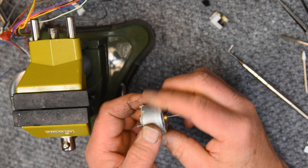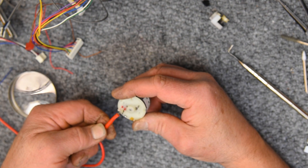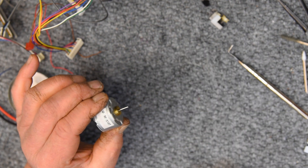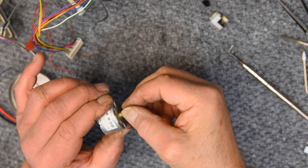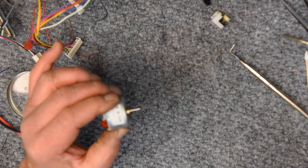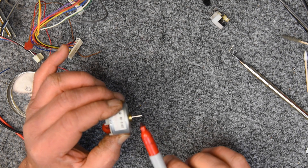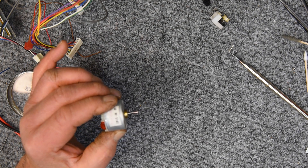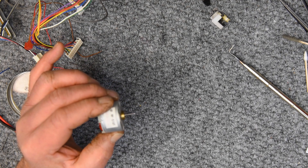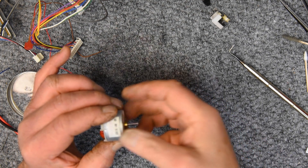I want to put a little bit of grease on the thrust side of the bearing — obviously just a tiny amount. Let's get it in there and see how it feels. Yeah, that's totally different than the way it was. I'll assemble this by putting the backplate on first, partially because I want to double-check the position of the brushes on the commutator. This housing is so short that it's easily assembled with just holding a finger on the front bearing — there's no danger of the magnet pulling everything apart and damaging the brushes. It's powered up, let's see how we did. That's good — that vibration seems to be gone. Just doing this for the camera so you can see the rotation — very slow, very low voltage, a volt or two, and it's turning even. The lowest voltage I can put on it, it's still turning.